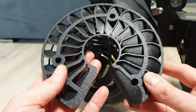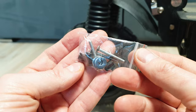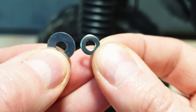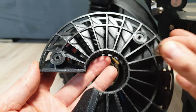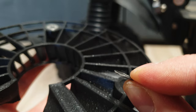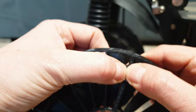Is it easy to install? It's actually crazy easy. With the cooler you'll get a bag with spacers, washers, and screws. There are bigger and smaller washers. Let's start with the bigger ones — the difference in size is quite visible. First, we have to push those bigger washers into the spots on the cooler. One side of the washer is flat and the other has a curvature — flat side goes to the cooler. You sometimes have to push it pretty hard.